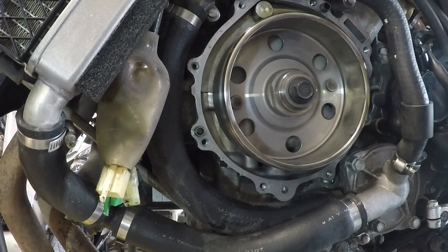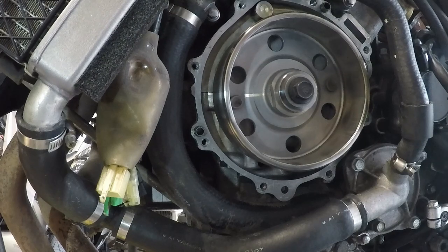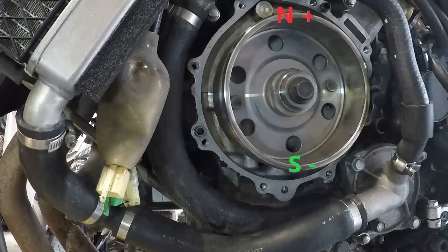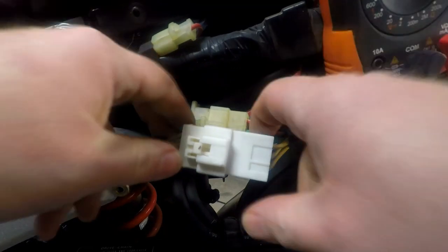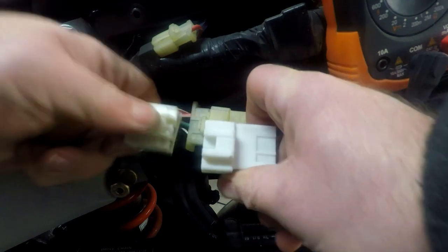The magnet in your motorcycle is in a drum that is connected to the flywheel of your engine. When the engine runs, the magnet turns at very high speed, passing both its north or positive magnetic pole and its south or negative magnetic pole over the copper windings. The voltage coming off the stator is high and fluctuates based on the number of times the magnet passes over the coil windings.